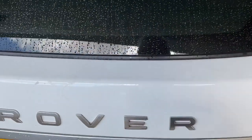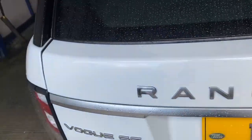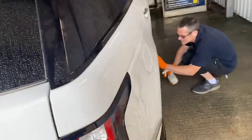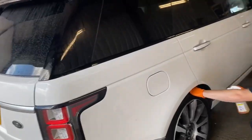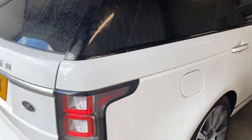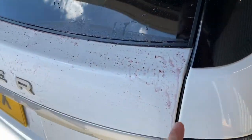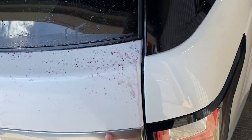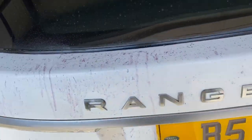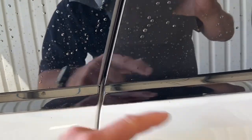I just need to note this — these badges: it's a normal thing that happens when they use strong chemicals. It hasn't had any chemical on it yet, only a degreaser product which won't do that. It's the acidic products that some guys use. The degreaser we're using is to remove the tar. This is actually Red Seven on here — it looks purply but it's a neutral pH product, very safe. It won't mark any lettering or trim. These have obviously been marked, as we showed in the earlier video, from a caustic-based product — usually what car washes use for cleaning wheels, but they sometimes get overzealous and go around the sides.